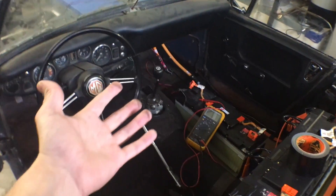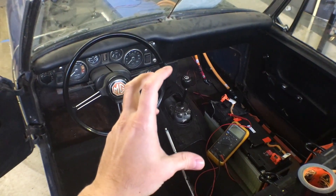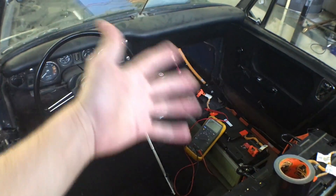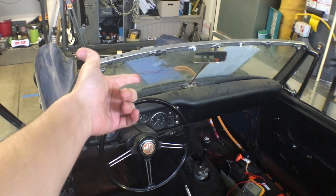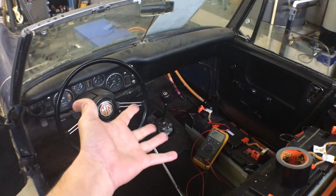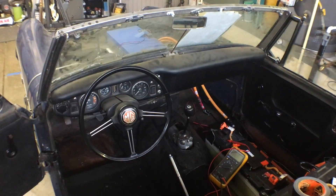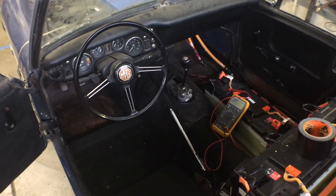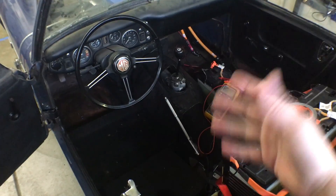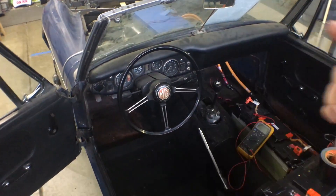It's one of those cases where you can't double-break it — it's already broken — so I'm going to take it apart without fear of messing something up. There might be some gear that's stripped out and I can just move those gears around, or force it to always be in third or fourth gear. Because with the electric motor, I could technically connect the shafts directly through with no transmission and I'd be fine. This car doesn't weigh enough, and I'd be able to pull away just fine with the amazing amounts of torque this motor can produce. If I don't see something obvious like a carrier member that needs replacing, I'll pull the red Midget in and yank its transmission out.